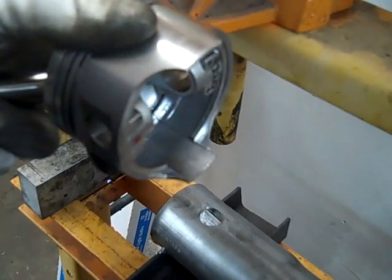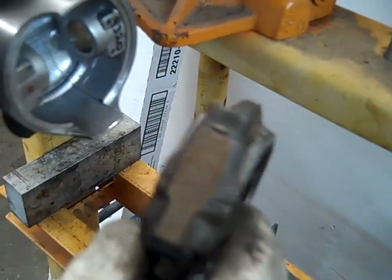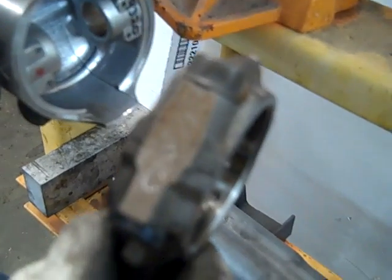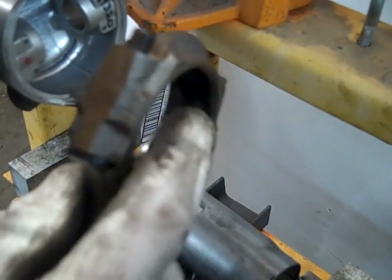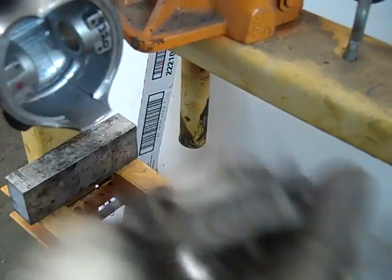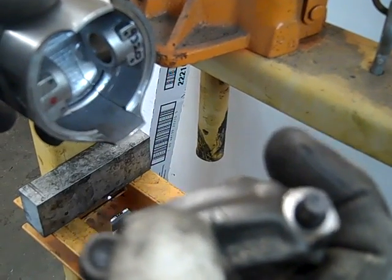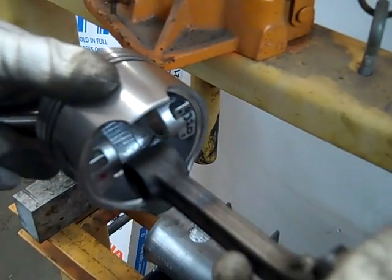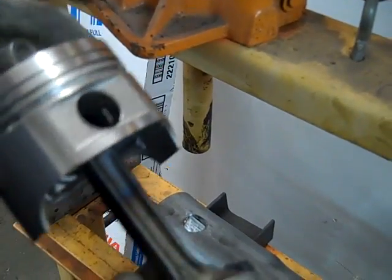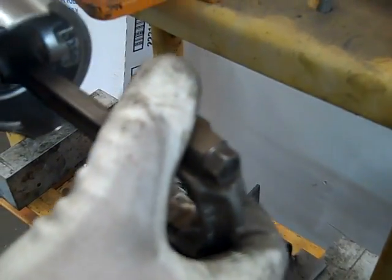What I'm going to do is show you how to set up a piston. We're going to take the arrow on the top of the piston and point that towards the wall for orientation. We're going to look inside the piston and you're going to see the two notches where the bearings come together. On the other side, there's nothing at all — that tells us the rod cap is on correctly. Then you'll see an arrow on the top of the rod, and depending on what year or rod you're using they'll have different arrows, but just find the arrow and see where it points. We're going to point that rod arrow to the wall as well, and that gives us orientation for the piston.